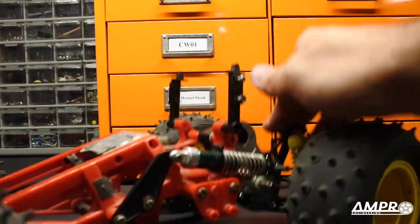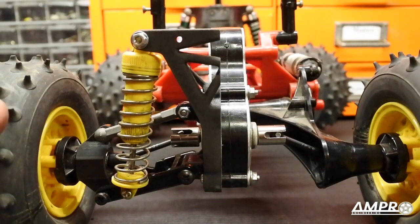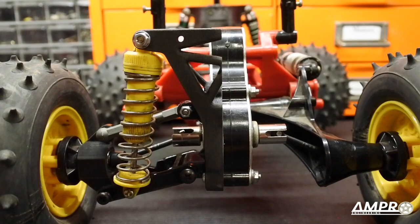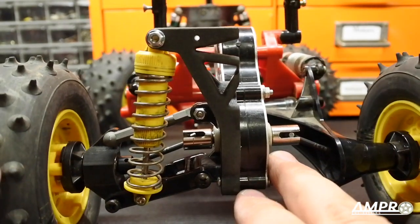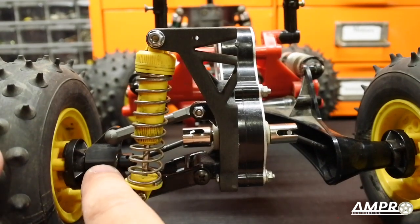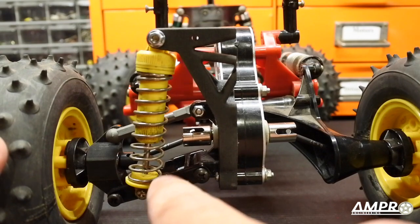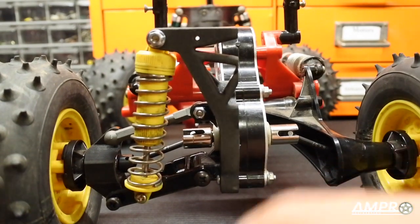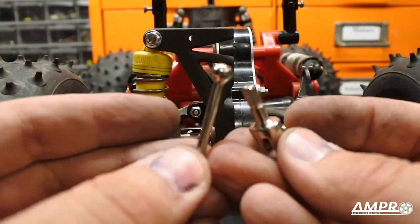I am going to make this vehicle operational soon, but there's a couple of little tweaks I want to do. If I was a hack I'd say it's good enough, but there's some geometry in this hub that isn't quite right to me, and I think I'm going to make the lower arm one millimeter longer simply because I now have the ability to. Before I let you go, let's go ahead and try out the dog bones.